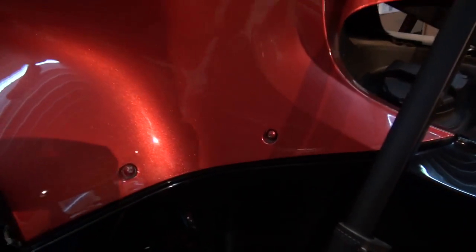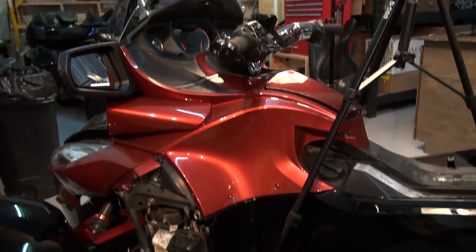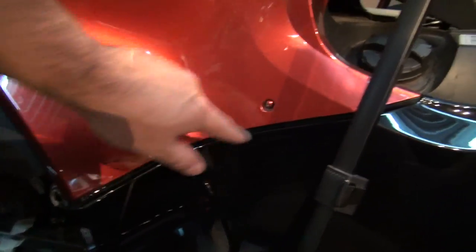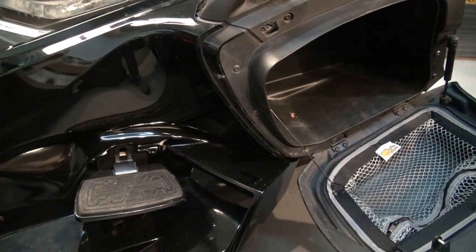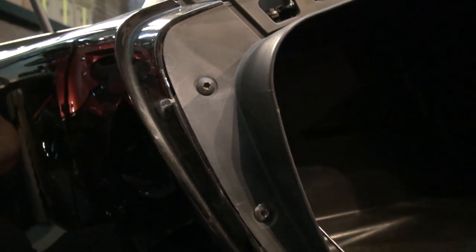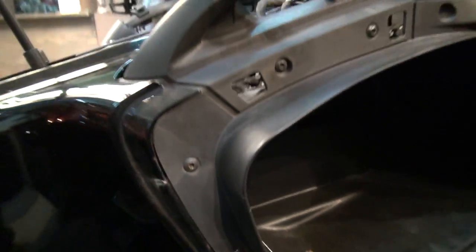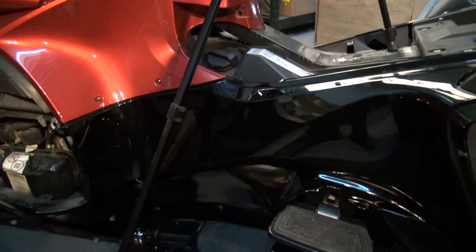The two pins we're going to need to pull on are right here — let me pull back so you get a better idea of where they are. These ones are not actually screws; they look like screws but they're actually push pins. As you open the rear saddlebag on the left-hand side, you're going to see two more screws to take out — one here, one here. Let's go ahead and take out those and we should be able to pry open a little bit of plastic here and pull out that side panel.